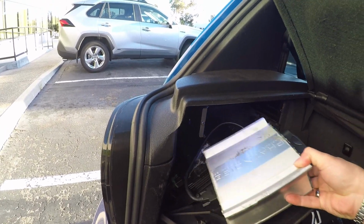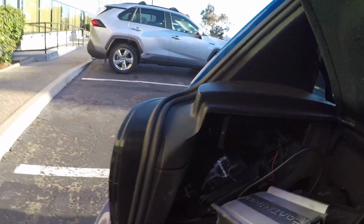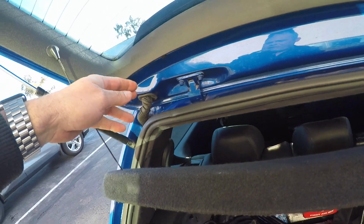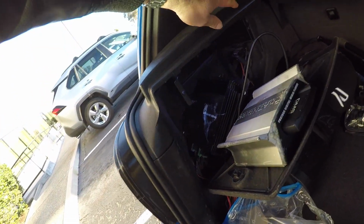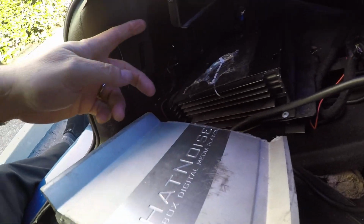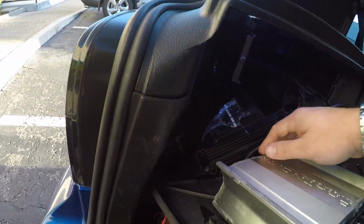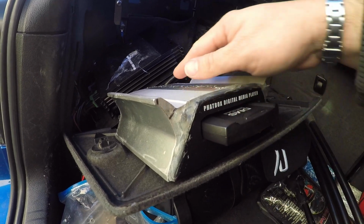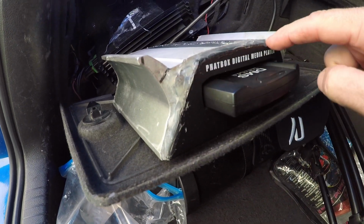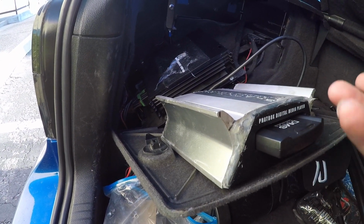Now what I've noticed is by doing that, there are many drainage issues in this particular corner of the car. Things don't absolutely perfectly seal with the taillight and with the sunroof drain that runs through there. And while in a perfect world there shouldn't be any water getting into here, what I found several times is water somehow came from either back behind the taillight there and splashed up in, driven by the wind or whatever, and got into the Phatbox and ruined a few of these units. And so what I've done is I've taken some sealant, sealed it on both sides to make sure that water won't get in, but still there's this big spot where the cartridge goes, and that's an issue.